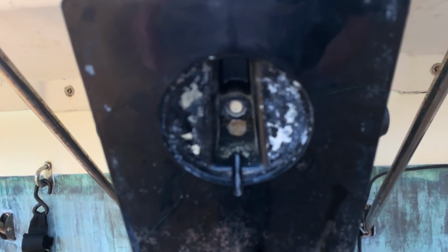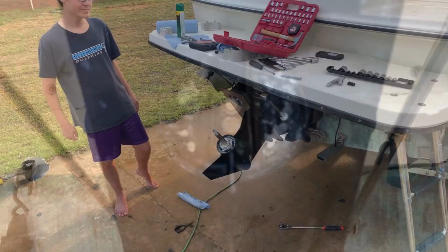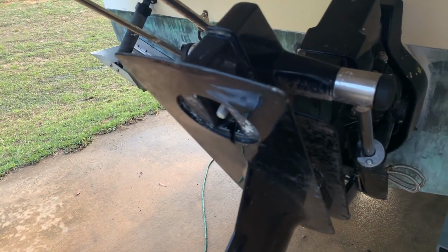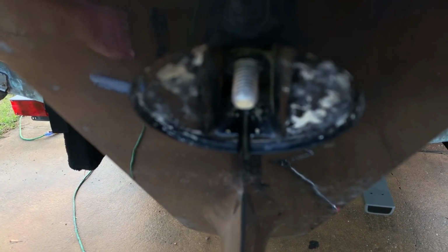Alright, there's the final bolt right there. Once you get the anode removed, that's where you've got to get in there, and I believe that's a 1/2 inch. So after getting the 4 bolts off the sides removed, there's one more bolt behind the anode and another one on top of the forward anode tucked in there. And those are 1/2 inch.